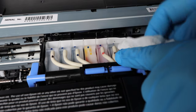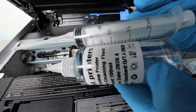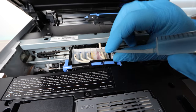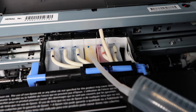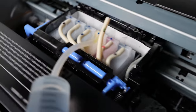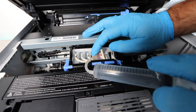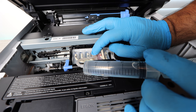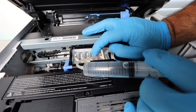Now you can begin working on the actual nozzle. The nozzle is very small, but this is what you're going to be pushing the cleaning solution through. Here is the Best Printers Cleaning Kit. You have 20 milliliters and I'm going to push the whole 20 milliliters through. I am placing the silicone tubing from the syringe right onto the nozzle. Once it's fully connected — even if you have to use tweezers to get it on — get it on all the way, and then you're going to begin pushing this fluid through. The silicone tubing is actually about the same exact size as the tubing used to push the ink through.